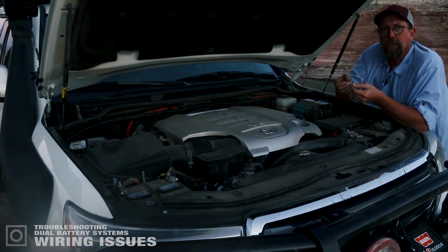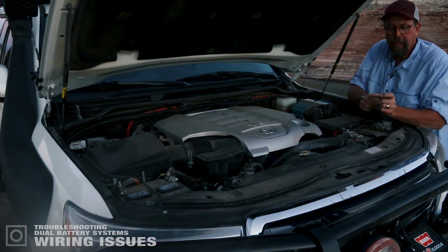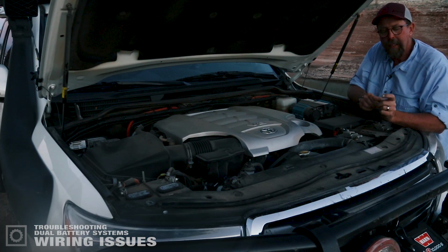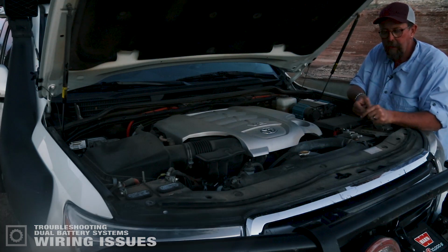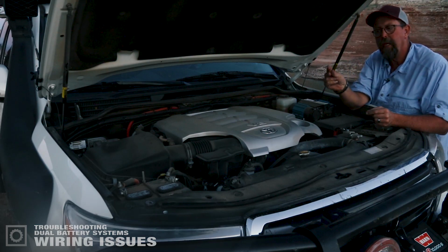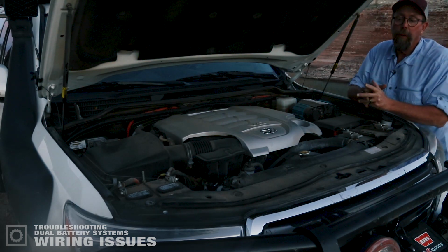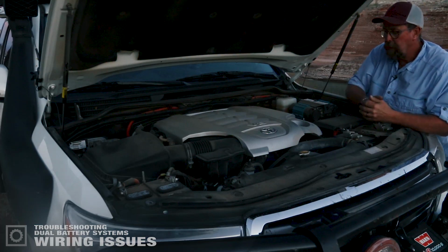National Luna's inline fuses are very interesting. It's called a mega fuse, and it's an inline fuse that you can't really tell whether it's blown or not. It's a 2-tab fuse that you put in line with a lug on one side, a lug on the other, and the fuse in the middle. The only way to test those fuses is to take them physically out of there and flex them in your fingers, between your thumb and your index finger. If there's flex in there, then the fuse is blown. If it's solid, the fuse is okay. So if you do use inline fuses, that's one thing you really want to check, to make sure that your fuses are in place.